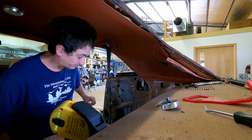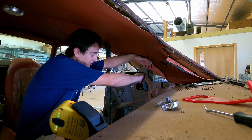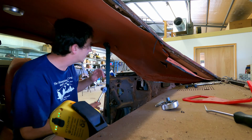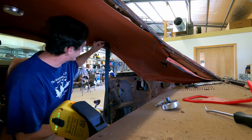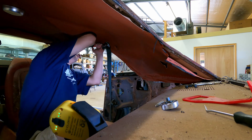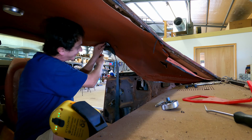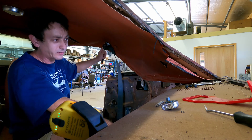So next, what we're doing is taking this headliner loose. We've got those holes for the vinyl trim on the outside that we're going to try to get welded up, but I don't want to weld with this material on the backside of them — we'll burn our project to the ground. We've got little clips for your coat hanger and your seat belt here. This just pops off and then there's a nut or a bolt. I forgot that my first vehicle didn't have three-point harnesses.